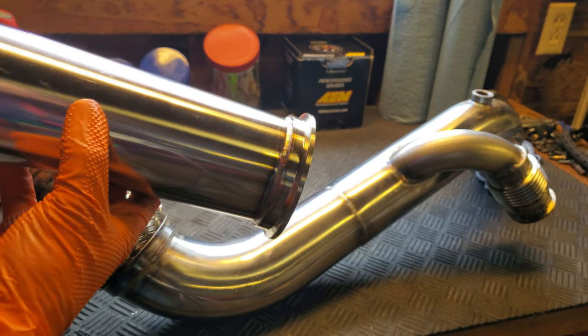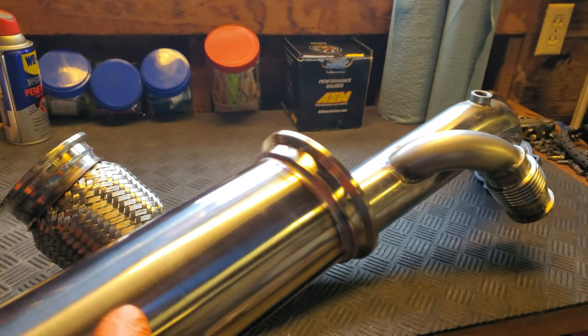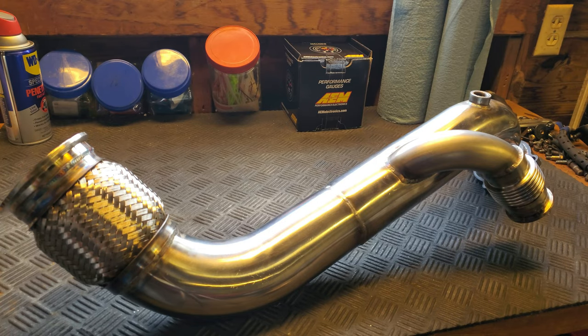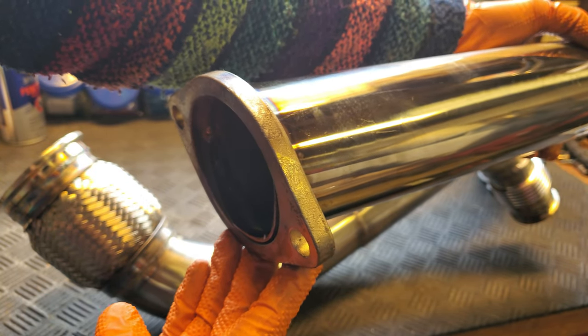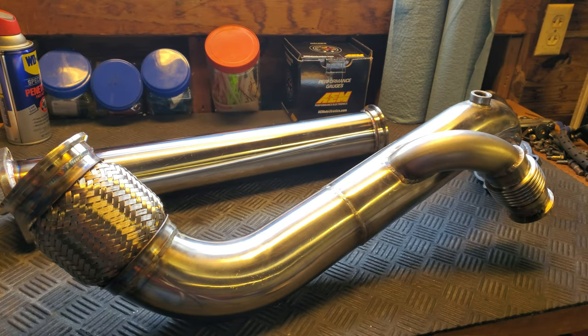At the end of the day, he ended up fabricating our downpipe with a recirculated wastegate dump and flex joints, a midpipe to bridge our downpipe to our catalytic converter. He drilled and welded a boost reference port onto our turbo because ours didn't come with one. He helped in extending a piece of our intercooler piping that you'll see later on. And finally, he welded in the intake air temperature sensor bung for our intercooler piping that you'll see in the next episode. So yeah, it really goes without saying that his help was priceless in getting this project done in a timely manner.